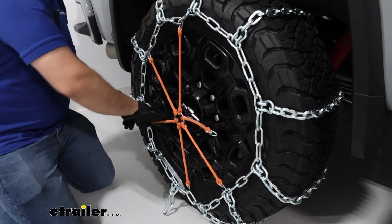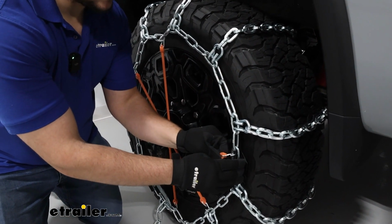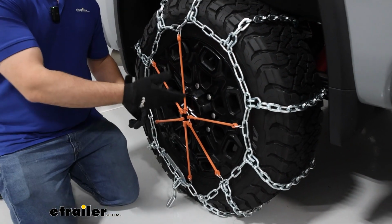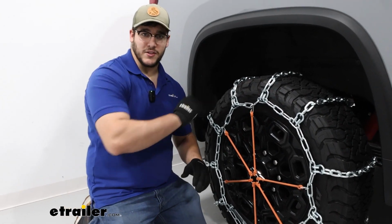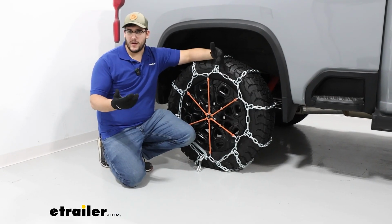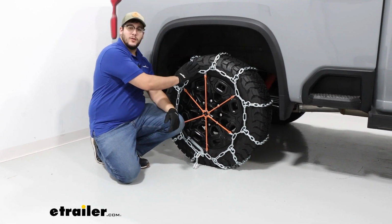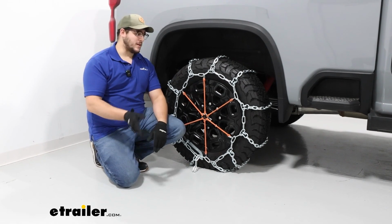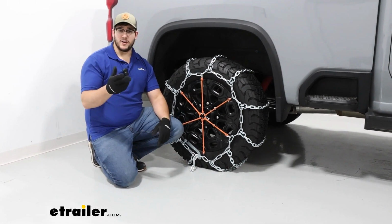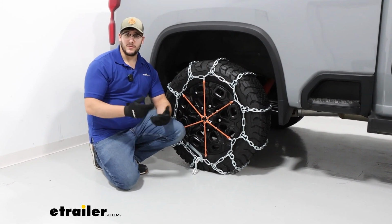When you place these on, we want to make sure that this metal hook is facing away from our tires so we don't damage them, and we put them on in a star pattern. With this on, we can repeat that process on the other side. At this point, I just recommend either pulling forward some or back some to make sure that fit is still looking good. And if it is, then you can hit the road. But that's just a look at the pewag tire chains on a 2024 Chevrolet Silverado 2500. Thanks for watching.